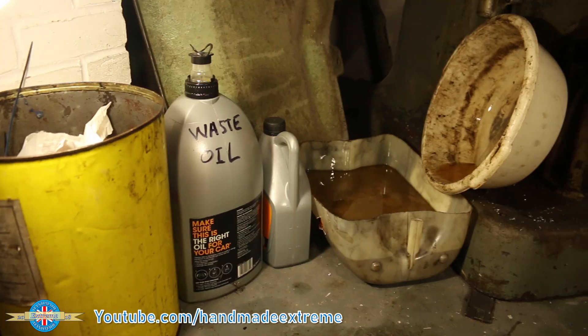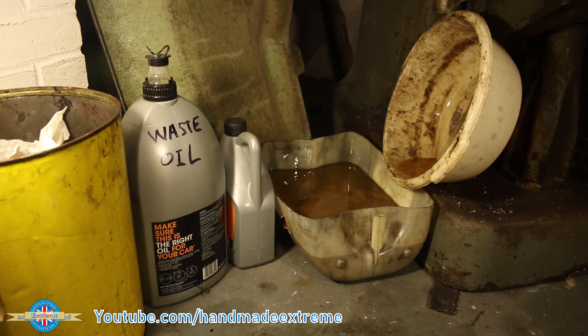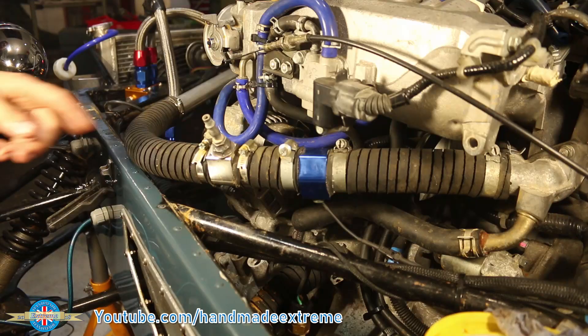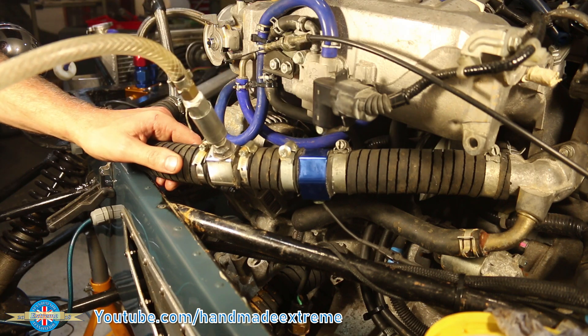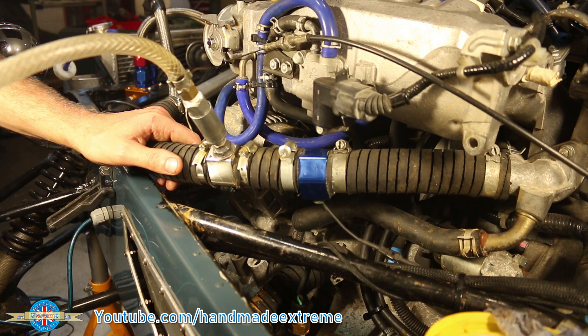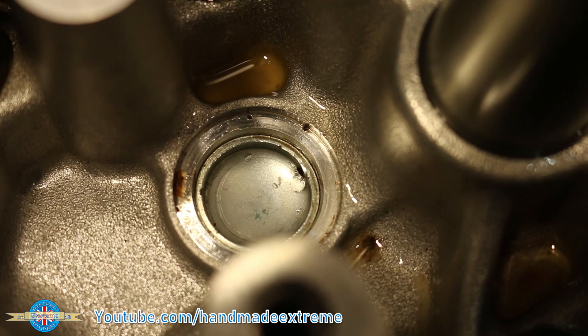Relocating the oil cooler behind the radiator has also worked — oil temperatures are now up to something sensible. When I got back from the test drive, I flushed the radiator through again with some radiator cleaner. And straight after I'd done it, there was mayonnaise in the oil again.